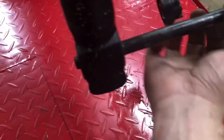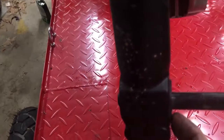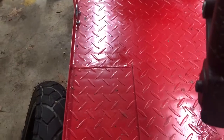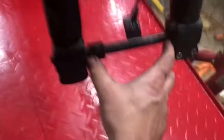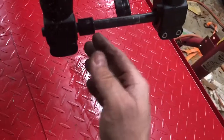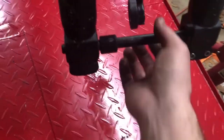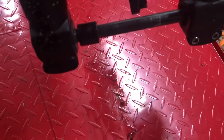What's actually happened is, because this doesn't have that spacer in there, it's got that area here, it's pushed in, and it's sticking out here. There are no threads visible here, and because there's not this spacer there to help push everything together, the wheel, the axle, the bearings, the speedometer drive, none of it is sandwiched together properly. And I get a very slight pulsing in my brake discs,